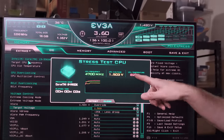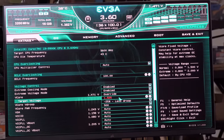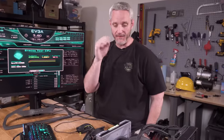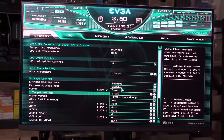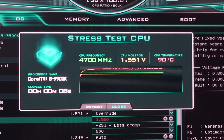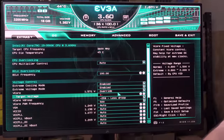Let's go 1.5. You went 1.425 to 1.5 because I'm trying to speed this up a little bit. 1.525 — it's red now, it's angry. What's going to happen here is it's going to hit that temperature limit, and if it hits that limit and doesn't go any higher, I have to find the setting somewhere in this menu to turn off those safeguards. This is a Kingpin board — it should not have safeguards, it should just come with a disclosure. 1.55, 1.575. I've gone 1.6 volts on an X299 7980XE, hit six gigahertz all core. This is now in territory where I've not really gone before. 1.6 — here we go. I'm not sure we're going to make it to two.